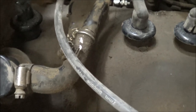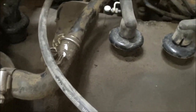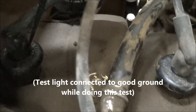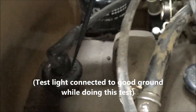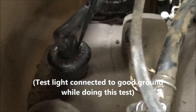Not the best. So I sprayed some water again on top of the boot — and look at that, you can definitely hear the misfire right now. And that will certainly cause a hard starting issue, especially when it's cold, because you need higher kV when the engine is cold.